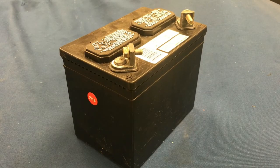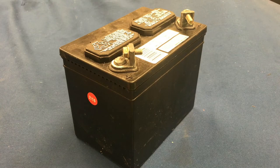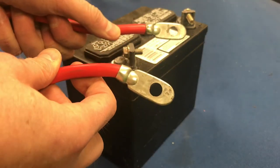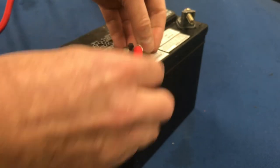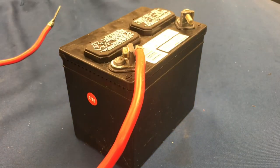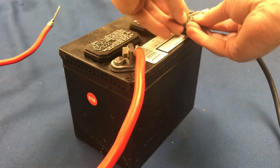You're going to need a 12-volt battery to start your 7, 9, or 16 horsepower engine. This is just your standard lawn and garden battery from the local hardware store. You'll also want a set of battery leads with terminals on both ends. Attach the positive terminal to the positive red wire, then take your negative and thread the nut on that side as well.